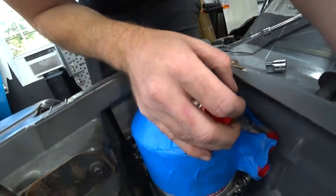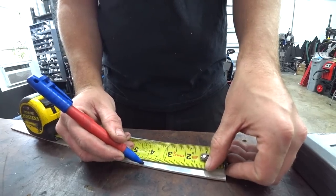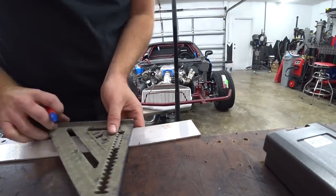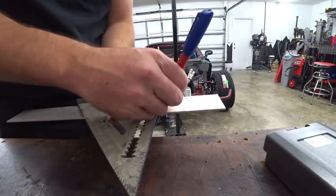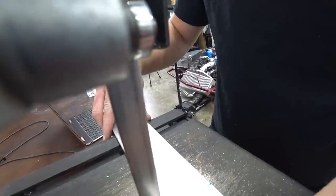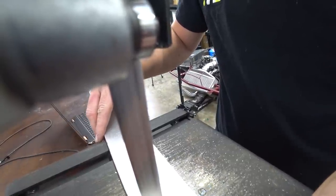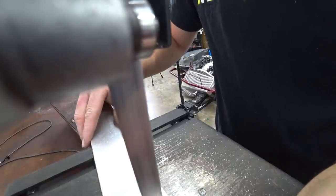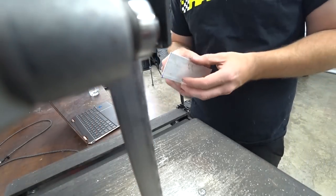This was not anything we didn't foresee — it was worth it to add another bracket, but now we've got to change our plan of attack. We've got to add one to the fender arch, which I was dreading, but we're going to make it work, make it easy, make it serviceable. We get our bracket marked out — just a simple little four-inch piece of flat bar. I am running low on this stuff, but we should have enough to make it through this project. We cut that on the bandsaw — aluminum is so nice to work with because it cuts, bends, and grinds so easily compared to steel. The only difficulty is it's a little trickier to weld, but it's a lot lighter.